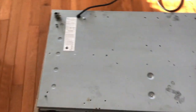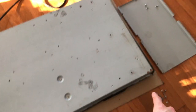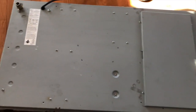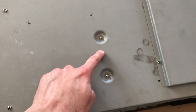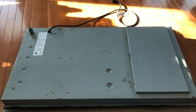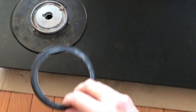The cooktop is flipped over. Properly align the screw holes, insert and secure the screws. In our case we have four screws that secure this plate to the actual bottom portion of the cooktop. Those little screws sticking out are what secure the module. From here put the cooktop back in the upright position.